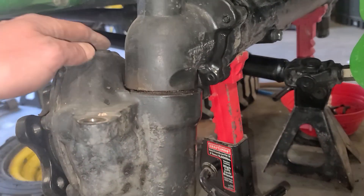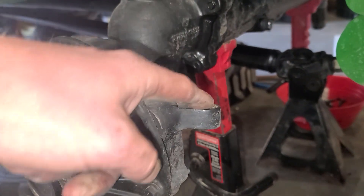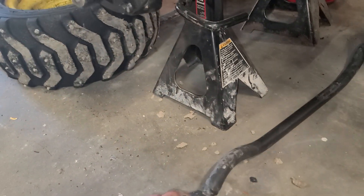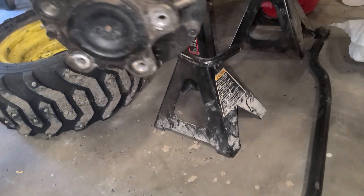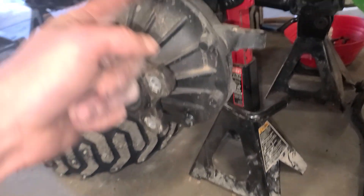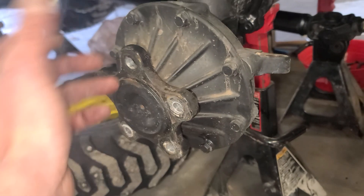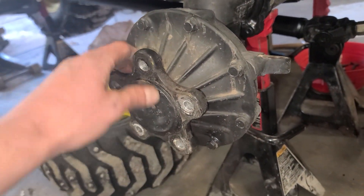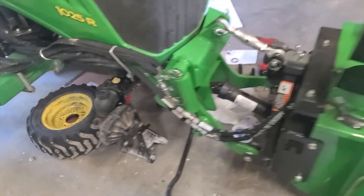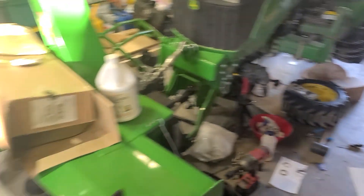This one's just seeping lightly. If it was like this one, I would not have changed it. In any case, this just comes out with these ball joints, and you've got to take off this steering arm here and take off these front bolts around here, pull it out, there's a snap ring inside, you pull that out, this whole thing drops off. I'm going to make a video about fixing that later on. I'm still waiting for the seals to come in, but what I wanted to show you is what it looks like when it's fully taken apart.